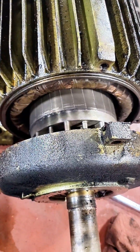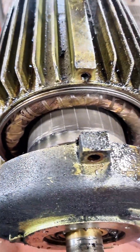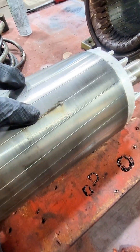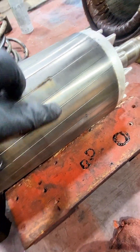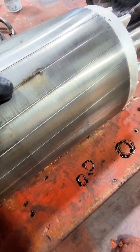At first glance, the winding looks like it's fine. But when we open the opposite end, we can see carbon that's built up right along that rotor. We're going to take a look at the rotor itself and inspect it for damage. Once we remove it out, you can notice these blemishes right along these skewed lines — but these aren't just skewed lines, these are actually rotor bars. Inside of this rotor, there are bars that are shorted by the end caps, and that is what is magnetically coupling this rotor to our winding.